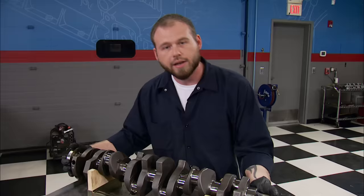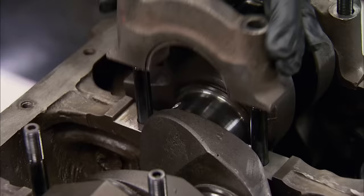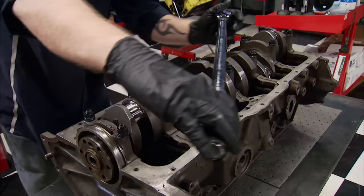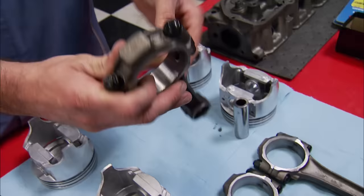These things were designed to make it all down low. Gently drop the crank into place, then drop the caps on in order over the ARP main studs that will hold the bottom end together. With plenty of lube, torque them to 70 foot-pounds. The factory rods measure in at 6.21 inches center to center, and we resized them using new ARP rod bolts.